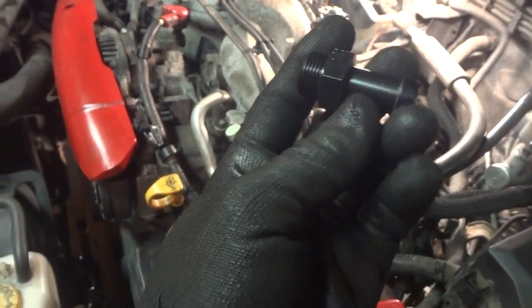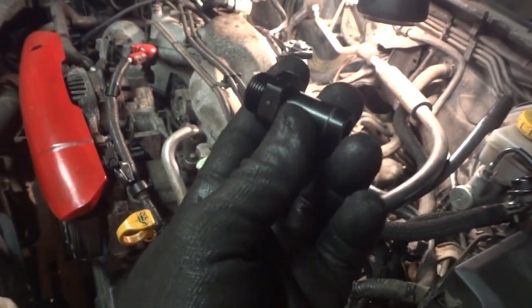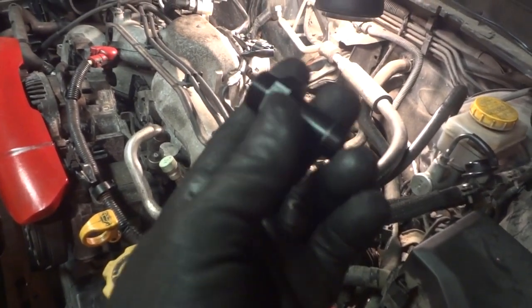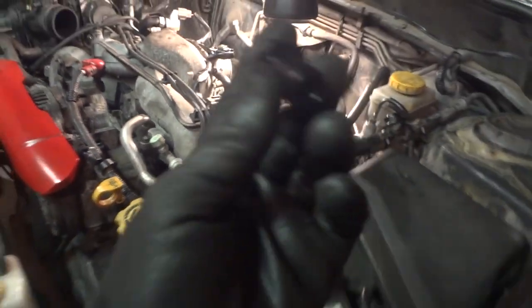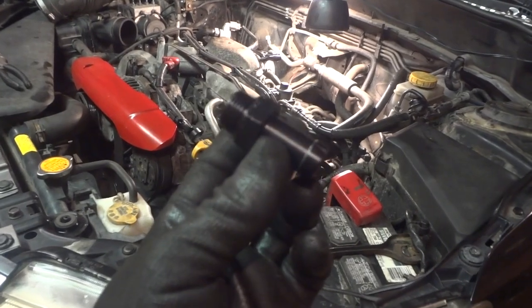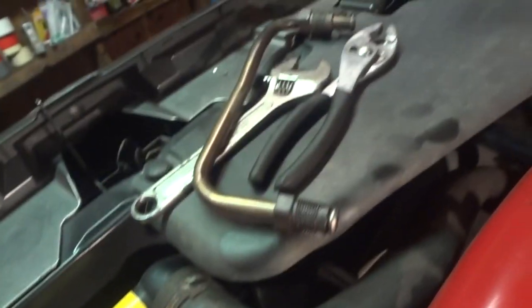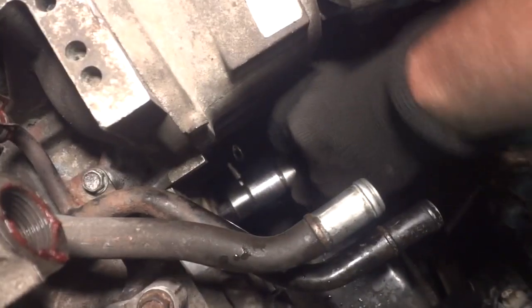I'm going to go ahead and get this in here and see what we can figure out. We tried to do it for free, but sometimes you know, it works. This is still worth 50 bucks to me because the day I was driving it, it was pretty hot and I could kind of hear the valve on this side rattling a little bit — I could tell this side was getting a little hot. I don't have a digital temperature gauge, but I know what they mean by that. I want to try to get this cylinder running a little cooler. No rambling — let's get this in. The plug is just about out, and yeah, I had to take the EGR tube out again — just no room — but once you break it loose it kind of turns with your fingers, just spin the bolt out.